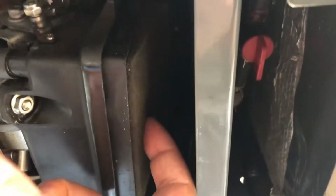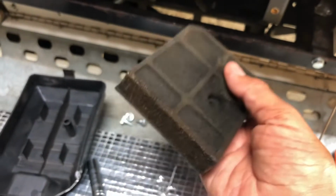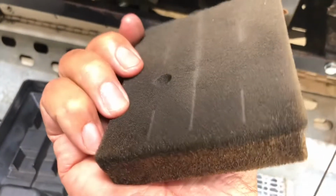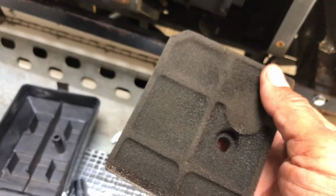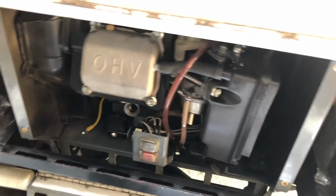Okay, pull it out. Then there's a little hole in the air filter. Stick your finger in there, and that'll stick to your finger. You can get that out of there. This is the part that needs cleaning. Mine's not too bad. So it does have some oil at the bottom of it. So I'll clean that up, put it back in there, and that's taken care of. But yeah, do that as well when you change your oil. Also clean your air filter.